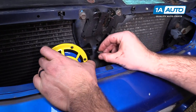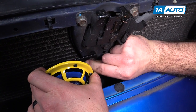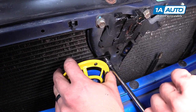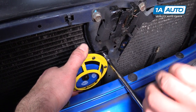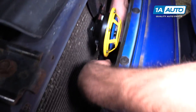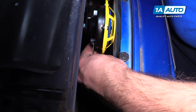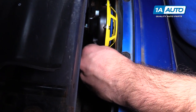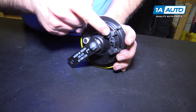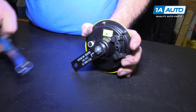I'm just going to install this horn. We're using this bolt — put it right back in the opening and tighten that up. I'll get it lined up so it's level, then tighten it down. I'm going to take our positive and just route it around from the other side — it was this lower terminal, just push it on. I'll do the ground after I have the other one installed. If you don't like the position of these terminals, you can just loosen this 13 millimeter nut and rotate it on the bracket.